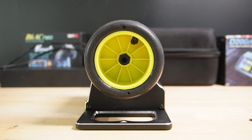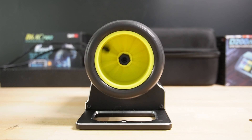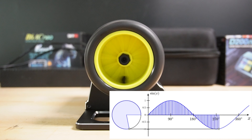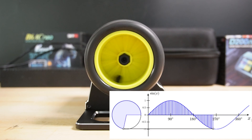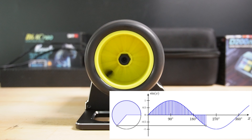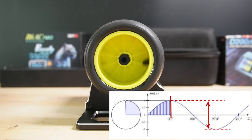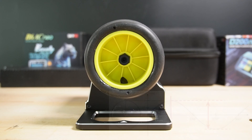The way this device combines its two main components is pretty clever. It spins the wheel at a set speed, and during this spin it's constantly checking the weight on that sensitive scale sensor — collecting data on how the weight changes at each angle of the wheel rotation, which likely forms a pattern similar to a sine curve. This happens because the imbalance in the wheel spins around and either adds or takes away from the total weight due to the centripetal force. From the gathered data, the software identifies the peak's angle and calculates the amplitude. The amplitude is used to determine the mass needed for balance, and the angle is used to position the wheel with the heaviest point upwards, so you can add the exact counterweight in the exact spot.